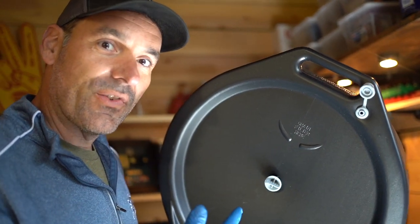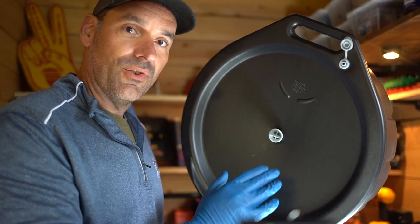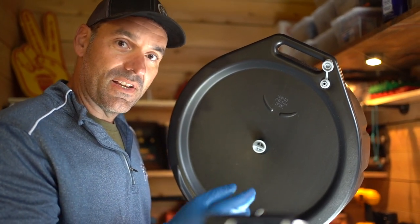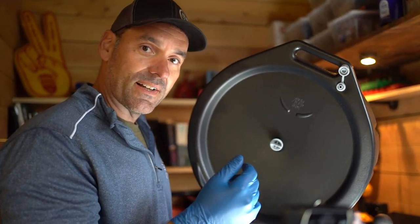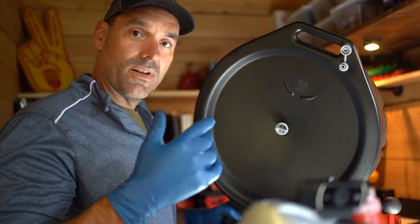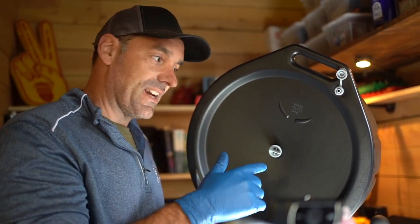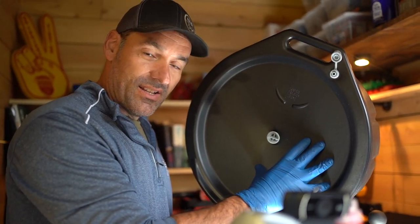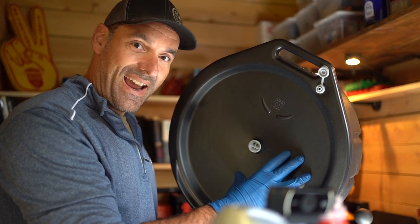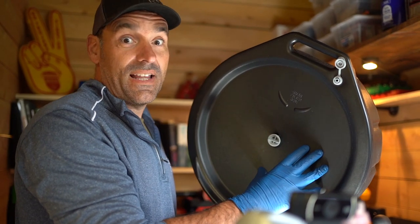And one of the things that Jose said before is that when you put this container down underneath the oil pan and you're going to unscrew the drain plug, position it in a location where the initial flow, which is going to come with a bit of pressure, is actually going to hit this and not necessarily right underneath the pan, which obviously the oil will be when there's less oil in the pan.